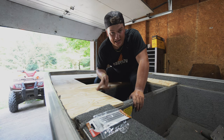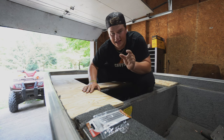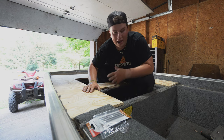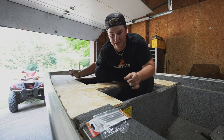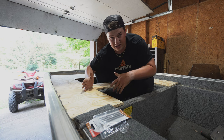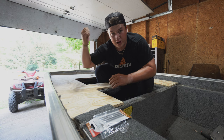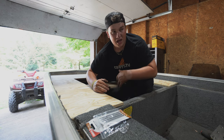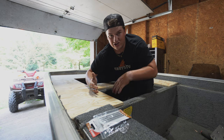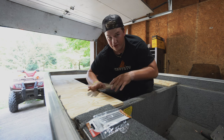One other thing that I need to do is I'm gonna rewire this whole entire boat. It used to have the little cylinder fuses. I'm gonna put all new blade fuses in. On the front and the back of the boat, I think I'm gonna put some USB or USB-C ports. And then I'm gonna mount a pole where we could put a GoPro. That way when we go out fishing, we can get a crap ton of fishing content. If Eric and I wanna do a fishing challenge video, or I just wanna take Dad on the boat and film that or whatever.